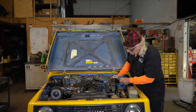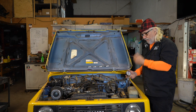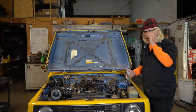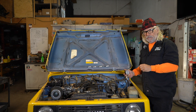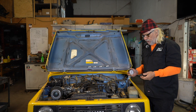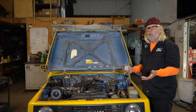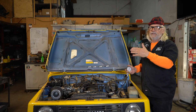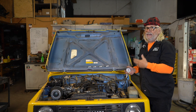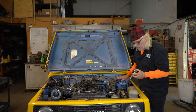There — you see it stopped at 155. As you know, the book says that 175 is peak, but below that is not peak performance. I see 155, so I know this engine's going to need to be rebuilt. But depending on how many miles the owner drives, this could go three more seasons. The problem with running them down is you get to the point where the engine may not be rebuildable. Bad things happen when you get to really low compression.